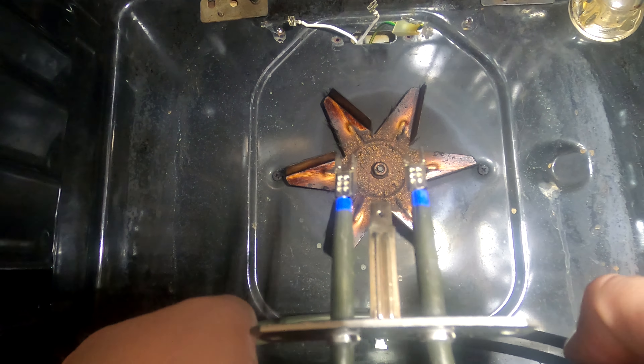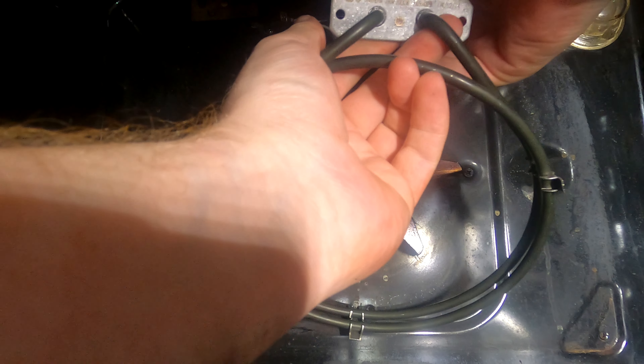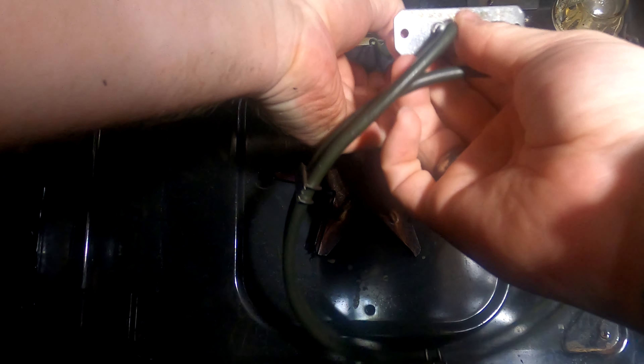What we've got to do is connect the terminal cables back on. The spade connector on this side goes on there, earth in the middle, and the other side. Make sure the tab goes on the outside. This plastic sheathing that was on the earth has perished quite badly - probably should use a new one really, but that's for another time. It does still fit. Now we've got it back in there, we've got to put all the wires back through the hole.